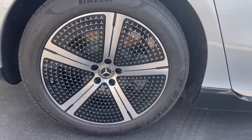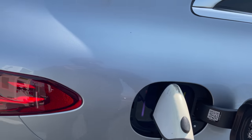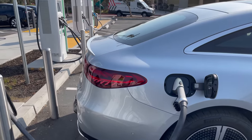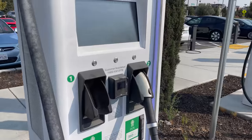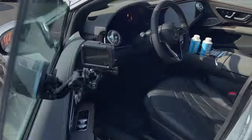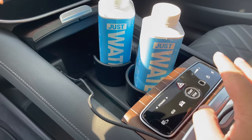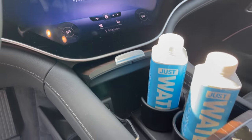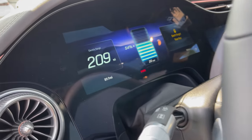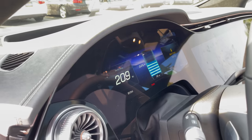Not the 200 kilowatts Mercedes claimed this would have, but it's likely not on fully production software. The screen glitched out briefly. At 54% state of charge we're seeing 154 kilowatts, showing 33 minutes to 100%. Then we dropped to 143 — typical charging curve taper. Really don't think this is terrible, but too early to tell. A second session confirms: at 63% state of charge we're at 130 kilowatts — a little more than a 'little bit' off the claimed 200 kilowatts all the way to 80%.